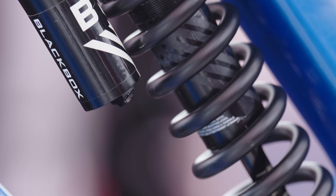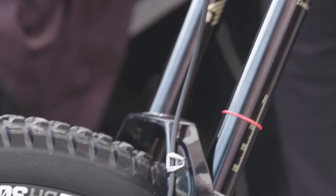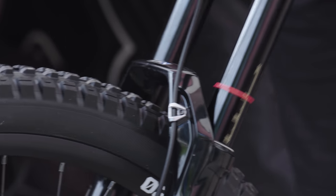What's going on inside I can't say, although I've heard rumors that the new damper in that Boxxer has a coil-sprung IFP. When you have a fork or any damper using a closed system, you need something to handle oil displacement. The previous Boxxer used RockShox's Charger system — a bladder that expands slightly as the oil column is pushed through the valves. They look to be moving to a coil-sprung IFP, literally a coil spring to handle that displacement. This isn't dissimilar from what Fox does with their Grip 2 damper, and Suntour have a similar system. The drawback is potentially weight, but in a downhill fork that's not so important. I can't imagine it'll be long until we see the full release of these forks.